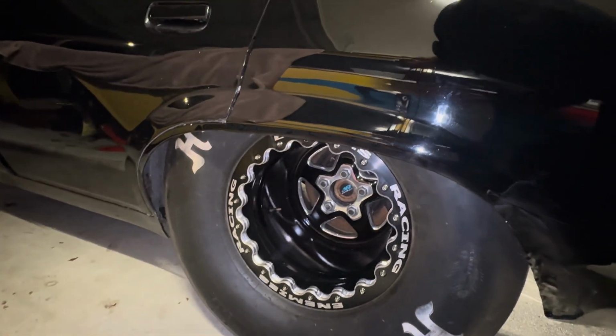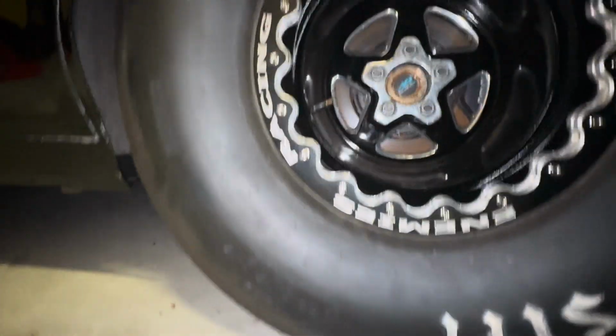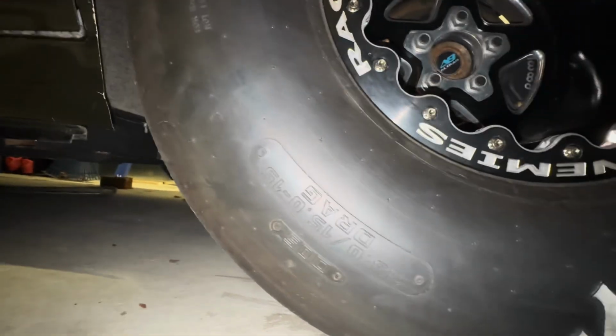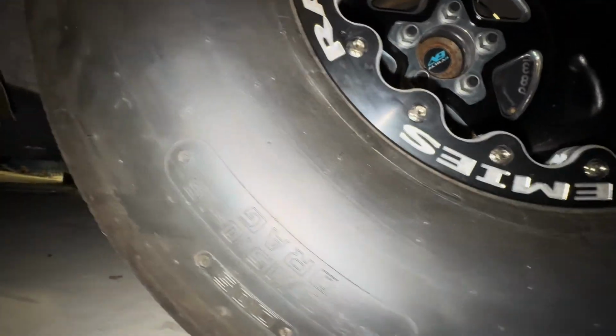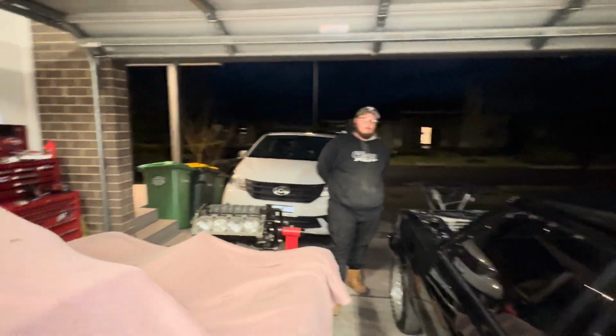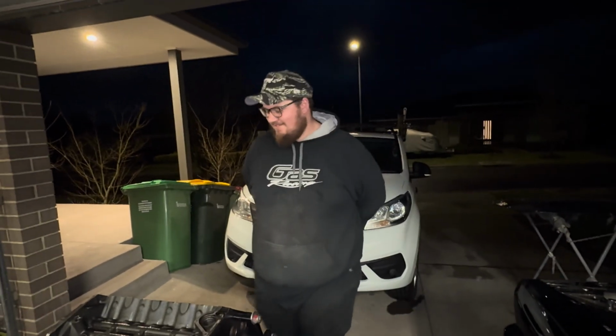It's got them big jumbo tyres. What are they? A 16-inch wide, 15-inch rim, or are they 16 by... It says right there, upside down. 33 by 15 by 15. Pretty wild, but we've got to change them to go smaller, to match the converter and engine. We wanted to get off the line sub 2 seconds. Get it by that 2-second mark.